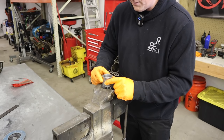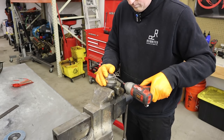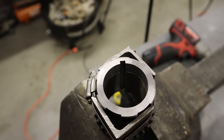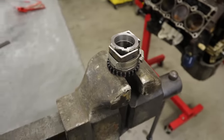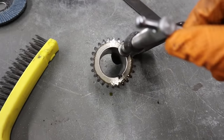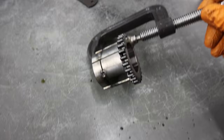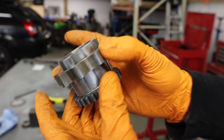This is just for testing purposes — I'm not planning to use this thing long term. Looking at the mock-up, everything looks lined up pretty well. However, I have to say I do not recommend this welding process: this timing gear has oil impregnated in it, so as I was welding it was spitting and popping and making a big mess. I welded it with some stainless rod just to be safe and it'll hold up, but this is not a good long-term solution.